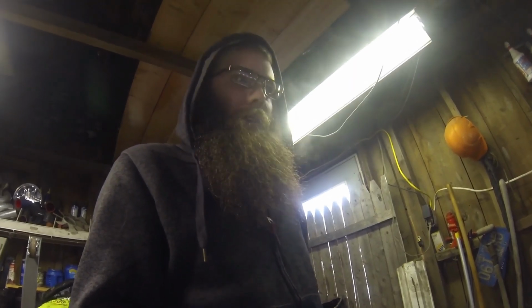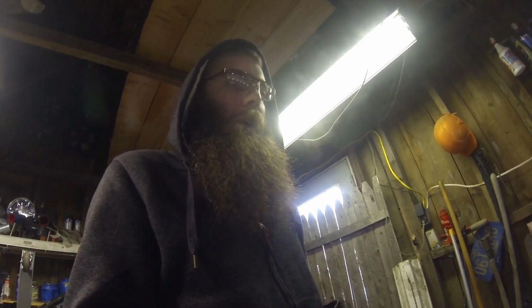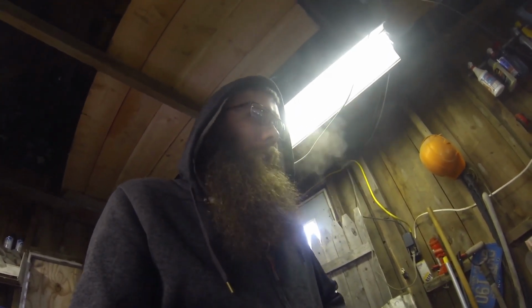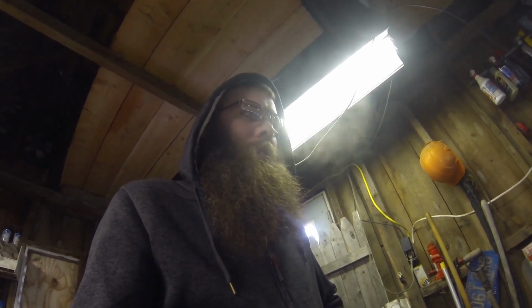And we had the Turbo Bay version 1 BWS with the AGP wastegate actuator. When we were on the dyno, I want to say we were spiking up there between 25 and 27 pounds, and then it would come back and hold about 21 to 22. The car made 371 after we got her all settled down, and made 430 foot-pounds of torque. It definitely had potential to make a ton more if we put a lot of boost in it.